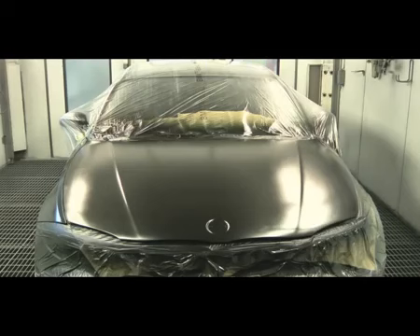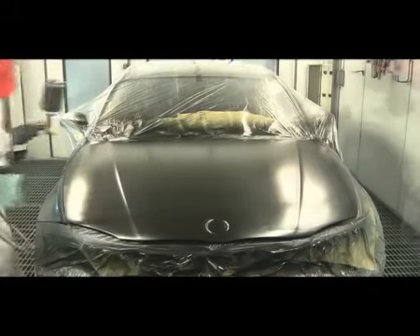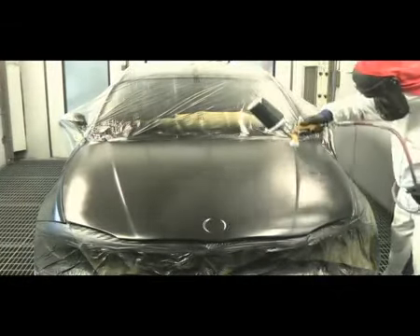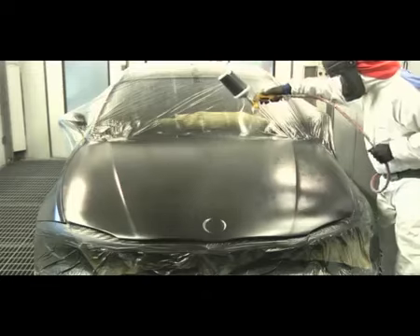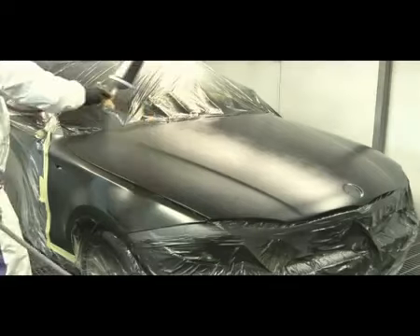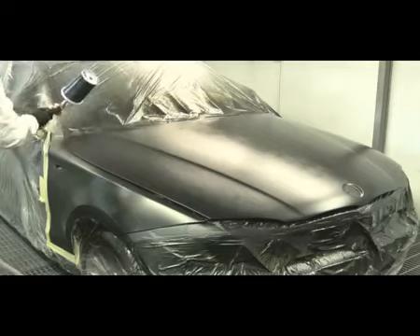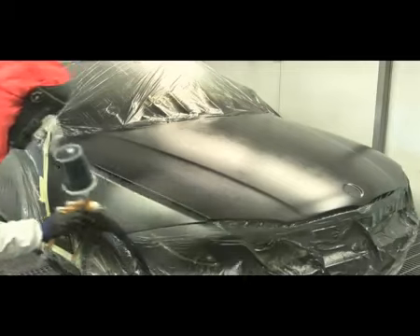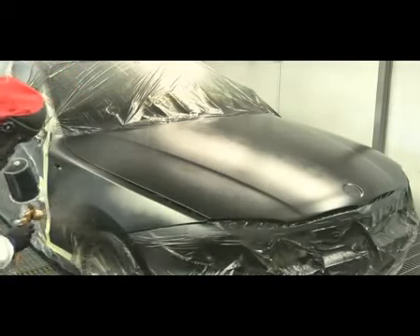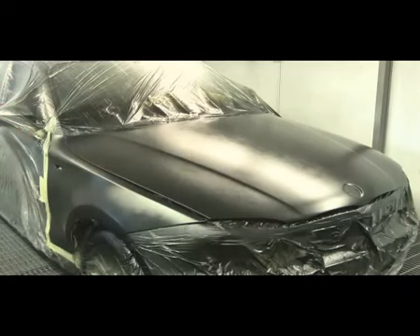Aquabase Plus is handleable between coats, so it can be tacked off prior to the next application process. Now all that needs to happen is the application of the light control coat. First, reduce the pressure at the gun to one and a half bar. Then increase your gun distance from the panel by an extra 50%. Apply a nice even coat for final appearance and colour matching purposes, and blend away the colour in the wing as demonstrated by the technician. This can now be left for a couple of minutes to flash off while the clear coat is mixed.